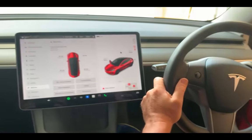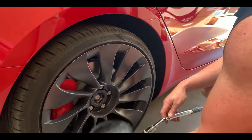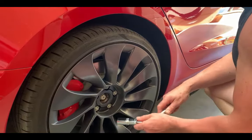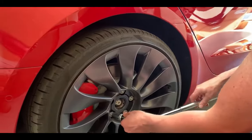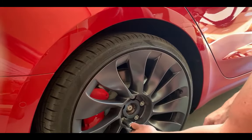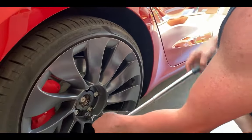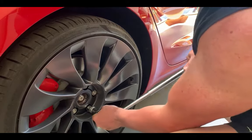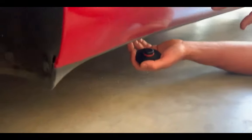Now let's change the wheel. The car is parked - take the cover off. These covers vary depending on model. What we want to do before we jack the car up is break the wheel nuts, so you'll see the 21mm socket will fit. Break the wheel nuts while the car is still on the ground.